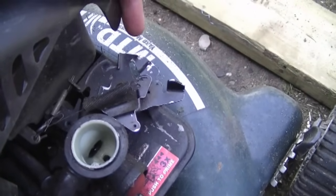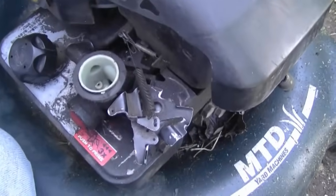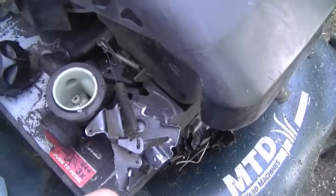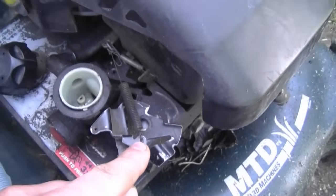It does work right now, but when it's in the full position the engine could rev a bit higher. The way to repair that is to either replace the spring here or cut a piece out of it to make it a bit tighter. What I'm going to do today is just cut a little piece out of the spring, re-loop it, and re-hook it over here — and that should make it rev higher.